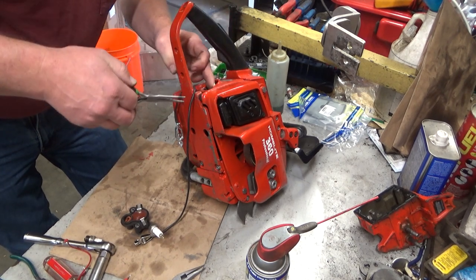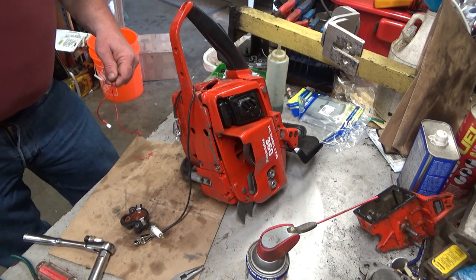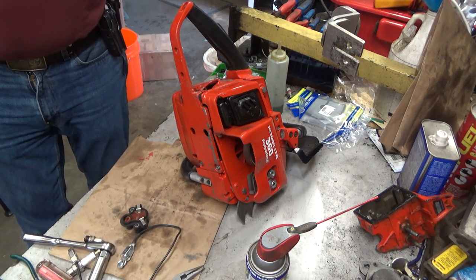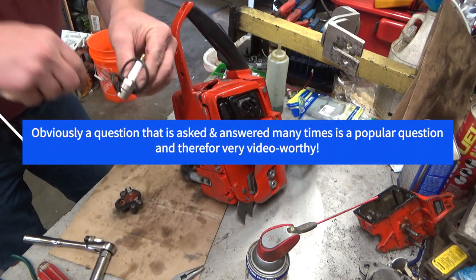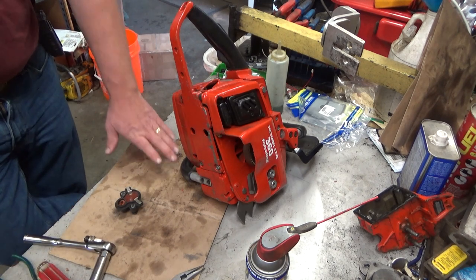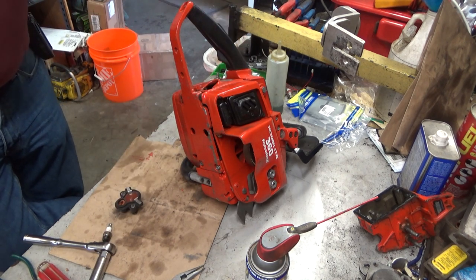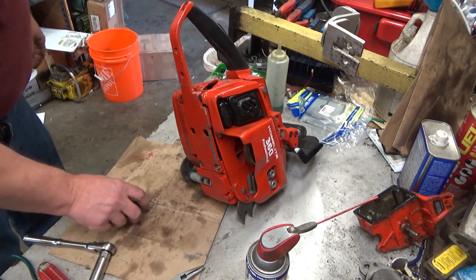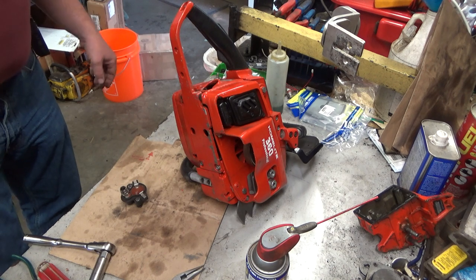This is an impromptu video — came home to another email about testing these ignitions, and honestly I get tired of typing the same thing over and over again. That's where some of the inspiration for some of these videos comes from, so I can reply with a video link instead. So what did we prove with that test when we got the plug to spark? Nothing, other than it has spark. You could prove that with the primer test. Because if it didn't spark on the prime or doing it this way, you still don't know if it's a transformer or if it's the coil. And since neither one are easy to find, you don't want to buy the wrong one.